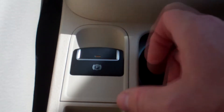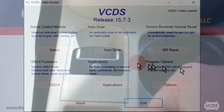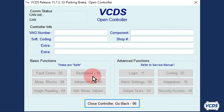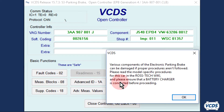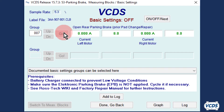Set and then release the parking brakes. With VCDS, click on Select, then 53 Parking Brake. Once the open controller screen loads up, go into Basic Settings, function 04. Did you hook up the battery charger? Click OK. Type in group 007 and then click on Go.